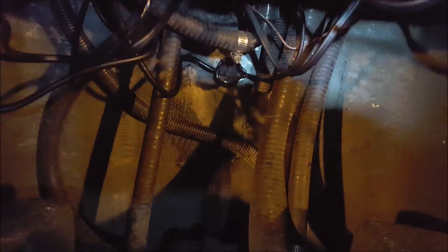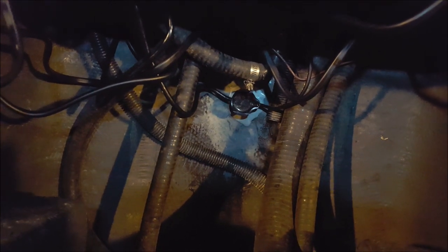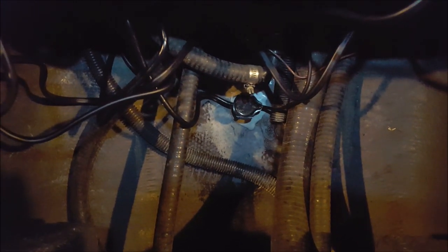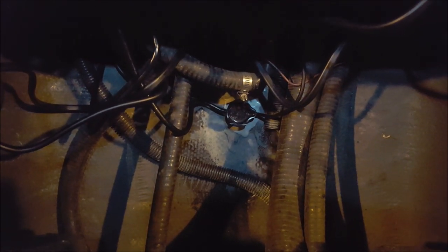I got down to the bottom of the hull where I found a flat spot. I was hoping to use the belt sander but just didn't have enough room, so I went with a regular little palm sander. I was able to get quite a bit of material off. Then I used a shop vac and vacuumed up as much dust as I could, and went down there with paper towels and rubbing alcohol or acetone to get it nice and clean — you don't want dust and debris when you're working with epoxy.